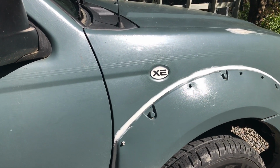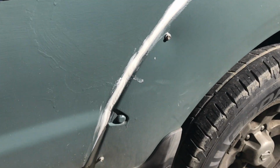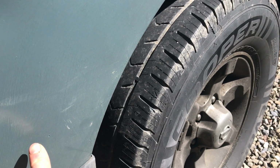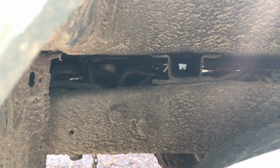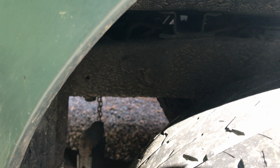Next thing I noticed, the truck is not as quiet as the brand new truck. I guess that's not a surprise, but I was going around thinking what might. So this right here is disconnected from the bed because of the rust. So I'm going to try to go underneath there and put in some aluminum, screw up in close to the wheel well so it doesn't go through my plastic liner, and then down into here, and hopefully that'll stop that. And that's on both sides.